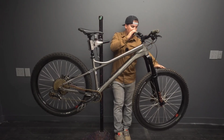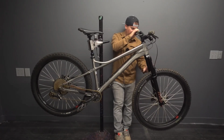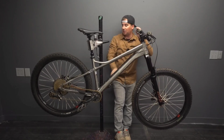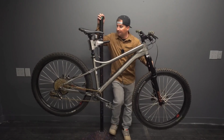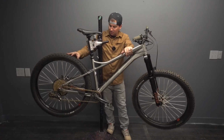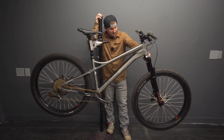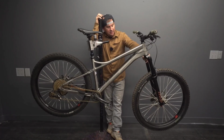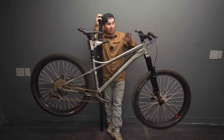We've got a Specialized Eliminator 2.6 in the front, Atomic Chubby wheel set with the Bird fiber spokes with i9 1-to-1 hubs. Really fast engagement. In the back, we've got a Specialized Ground Control 2.6 tire. I'm running the MRP Ribbon 150 mil travel up front. That's what this bike was designed for. It's a 27.5 fork, not a 29er fork. That's important to differentiate because that changes the axle to crown.